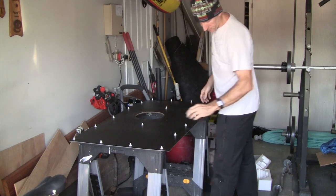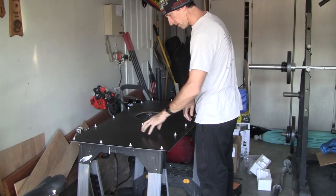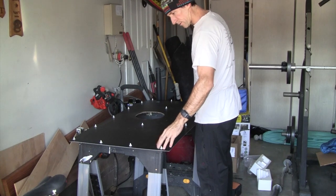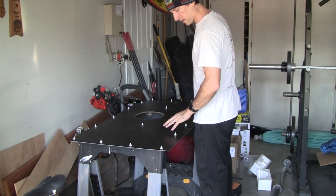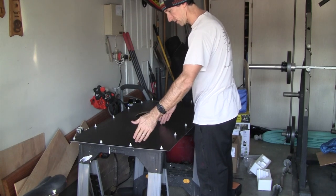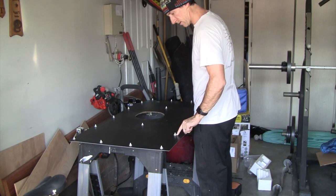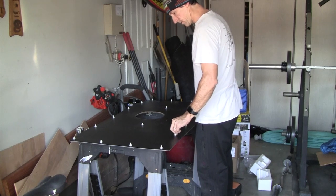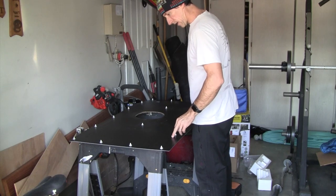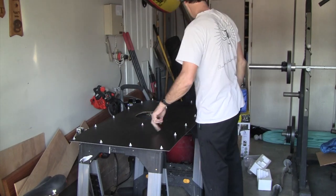All right, for the other rear passenger speaker, we're gonna mount that kind of in the mid-section of this panel. So I took some measurements in the van, and the panel that is closest to the driver is about 13 inches wide. This little plug here is about 4.5 inches in, so we want to get to about 6.5, and then kind of come up to the center of this metal panel, and that's where we're going to make our cutout.